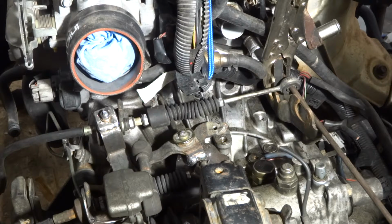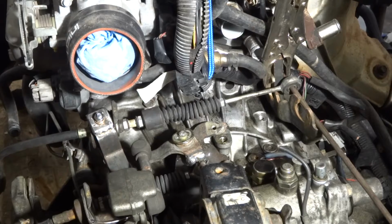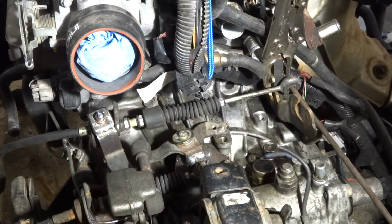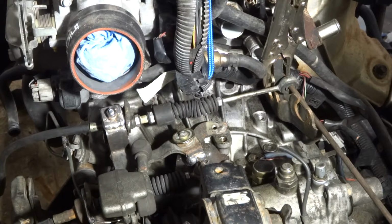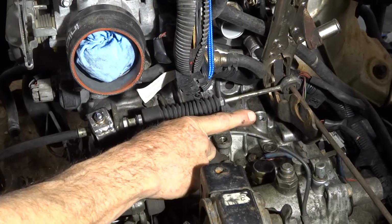While this reverses the direction that the shift cable is coming to the shift linkage from, it does not reverse the direction of the throw. So if the shift lever is moved to what originally would have been the left, all of this is an extremely long explanation of how I designed the linkage backwards. So what I ended up with is reverse being forward all the way to the right instead of forward to the left like it's supposed to be on the car, requiring a redesign of the shift linkage and firing my engineering department for total incompetence. Gotta blame it on somebody. Lengthens the rod and pushes this away from the original cable.